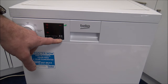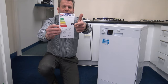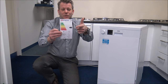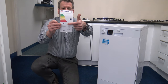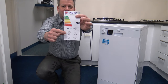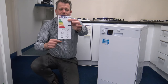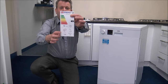You've also got the start and pause option on the right-hand side. I'll just show you the energy label — it's showing an E energy rating, and overall an E energy rating for this kind of slimline dishwasher isn't too bad. I know it's not up in the realms of the A's and B's, but comparing it to other slimline models, that's not actually too bad. It's showing 76 kilowatt hours per 100 cycles, 11.9 litres of water for the Eco 50 programme, and 49 decibels for noise.